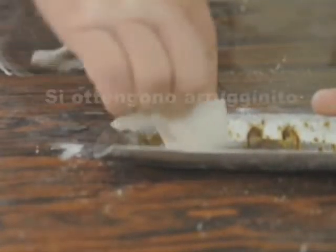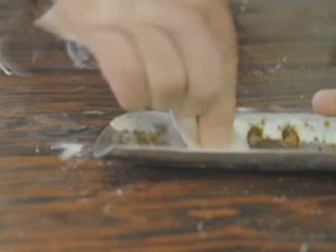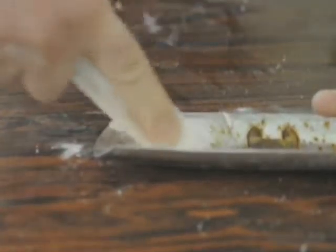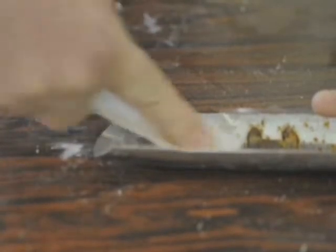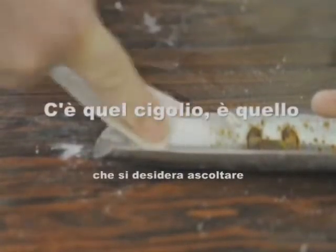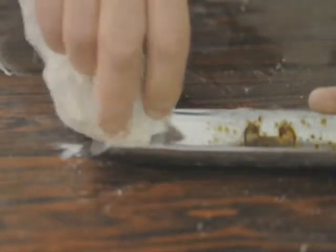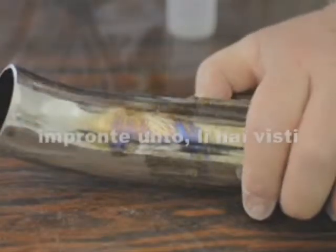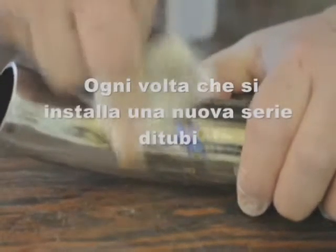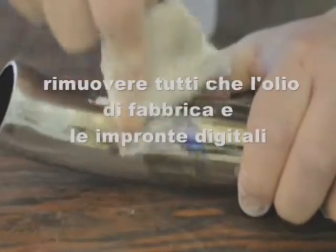Here's the grip cover, here's the pipe cover. They get rusty. There's a squeak — that's what you want to hear. Greasy fingerprints, you've seen them. Every time you install a new set of pipes, be sure and clean them with Blue Job and get all that factory oil and your fingerprints off there before you start that engine so you don't burn them in.